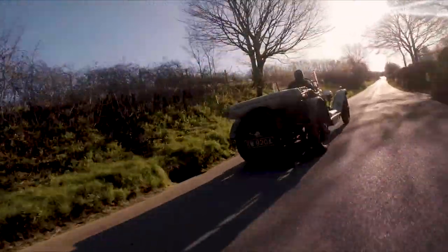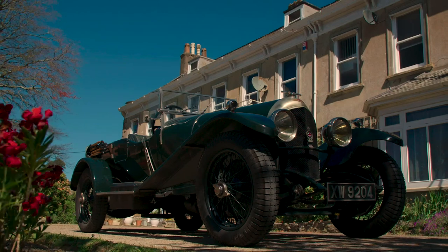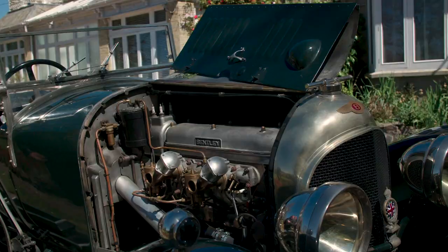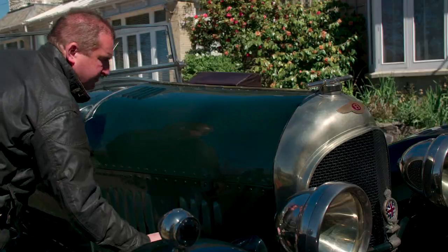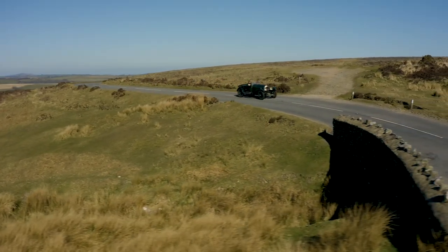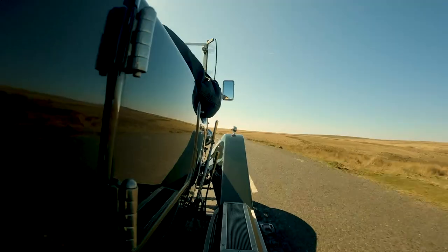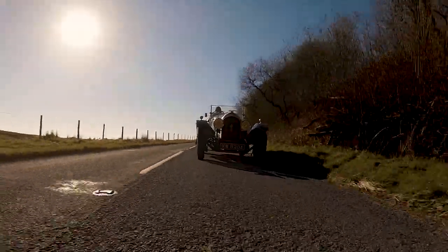This is a working car, so we've had lots of fun with her. She's done laps around the Le Mans circuit, which was huge fun. We drove her down to Italy over the Alps, and she's done numerous trips down to France and through Spain. The single thing that's all-encompassing, I would say, is the design of the engine — designed in 1919. It's an engine with four valves per cylinder, twin spark plugs per cylinder, and an overhead camshaft driven by bevel gears through a turret on the front. I don't know another engine like it. The design was revolutionary then and it still is revolutionary now.